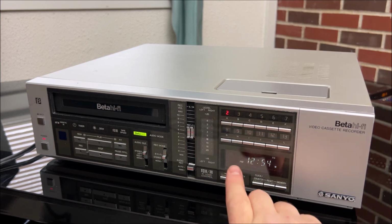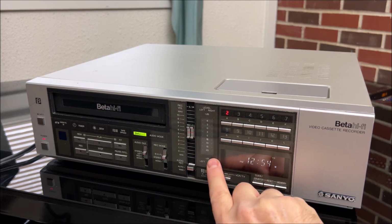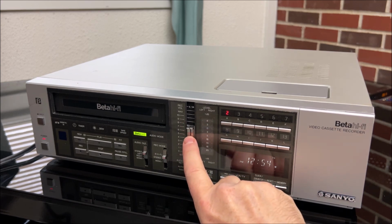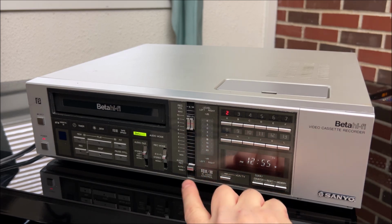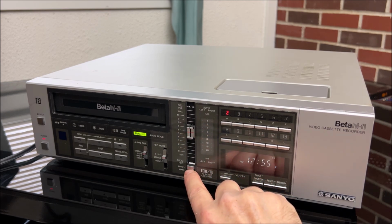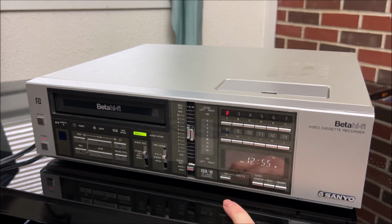Moving to the left of our channel selection here, we have dual VU meters for the hi-fi stereo audio. So we have left and right. We also have regular potentiometers there to control the audio input. If you wanted to use this as an audio recorder, you could have done so. And then underneath those sliders is audio record, auto, or manual. So if you didn't want to have to mess with these, you could just put it on auto and the machine would take care of those volume controls for you.